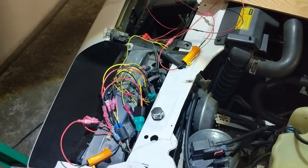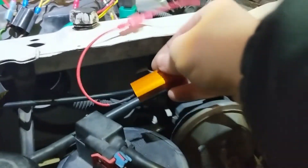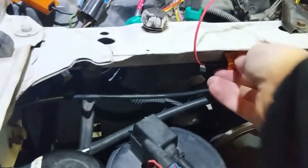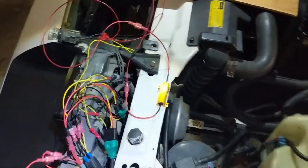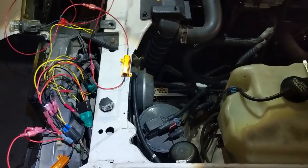That is how it's all wired up. I'm still not sure where I'm going to mount these resistors — I think I'll try right under here, but it's kind of difficult to get in there. They get really hot, so you're supposed to mount them on steel somewhere, not plastic.